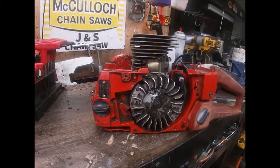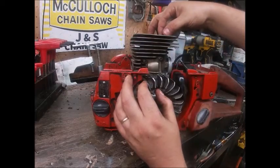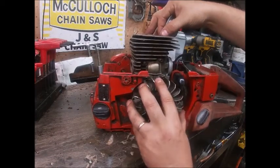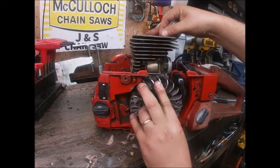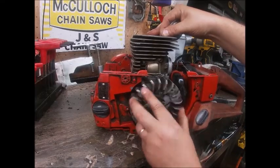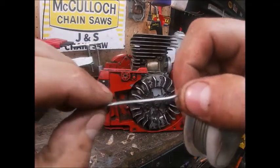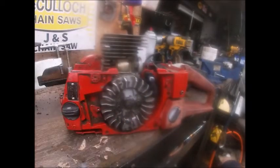Alright, we're ready to check squish. I don't have rings on it so I'm gonna try to position the piston as close to right over the wrist pin as I can. We'll still get a little dwell but it shouldn't throw it off much. She's mashed pretty thin - I'd say she's tighter than 30 thou when we check it.